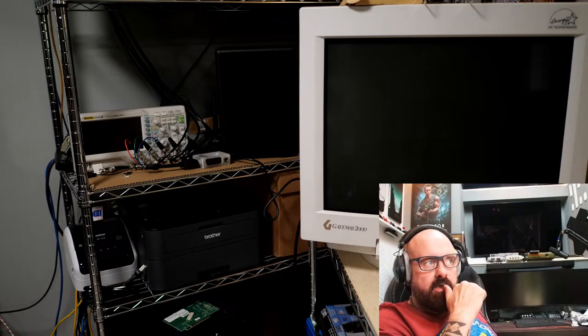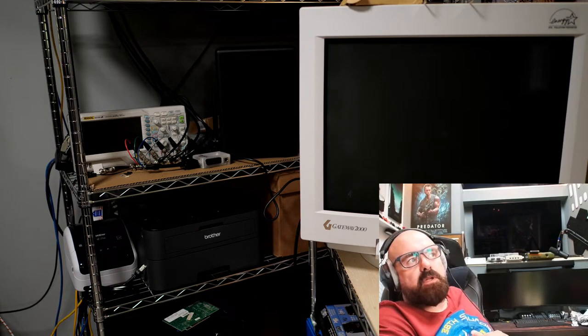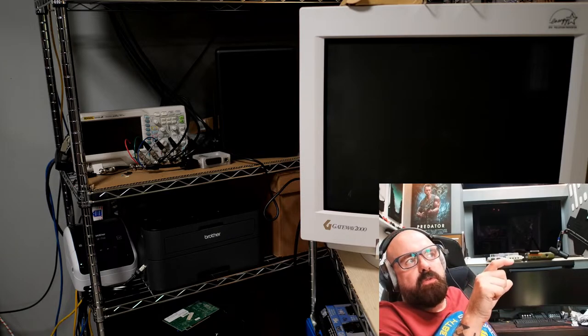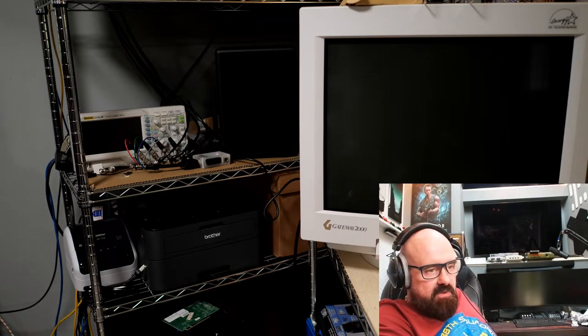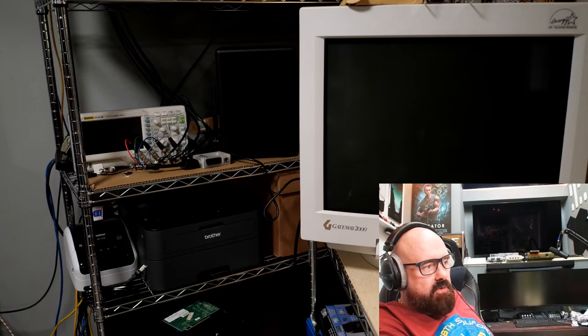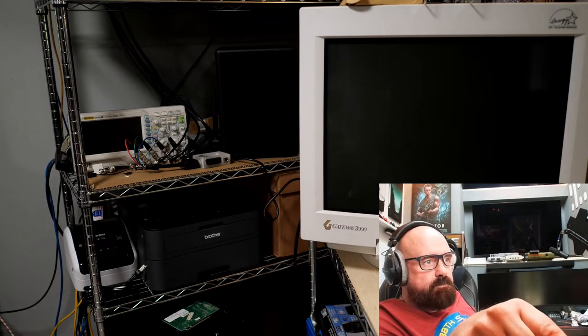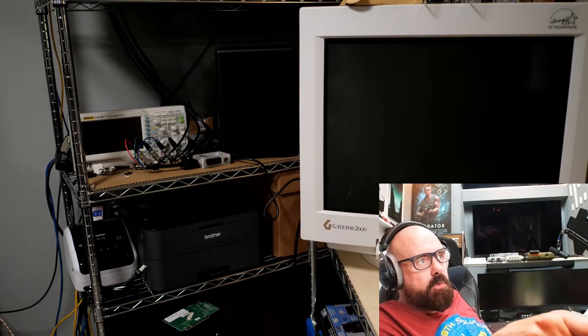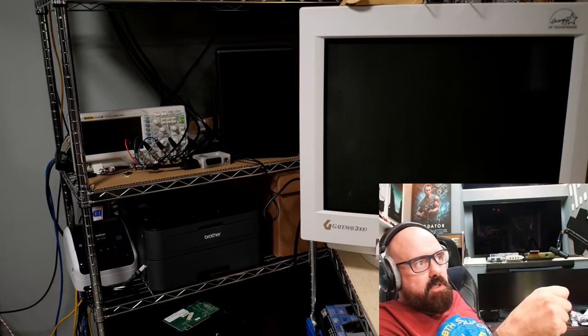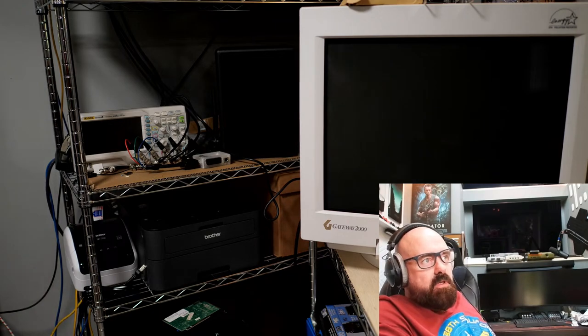Yeah, and one more thing I'm going to try is there are some beta sound drivers for Unraid. I'm going to speak to the dev about them. I know they don't work on my server, the beta drivers. They don't pick up my sound card. But if I plug in a cheap $5 USB sound card from Amazon, it picks up that. So what I'm going to try and do is emulate the Sound Blaster to use the host sound through that USB. Okay. And then that will give people a way forward to be able to run the VM, buy a $5 USB sound stick, and then be able to have sound and video. So that's what I'm going to try and do.